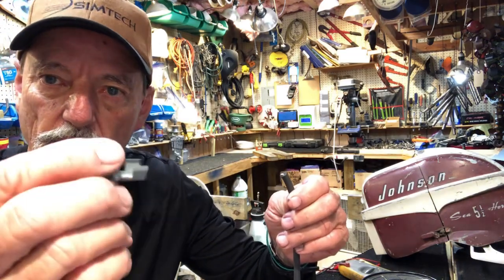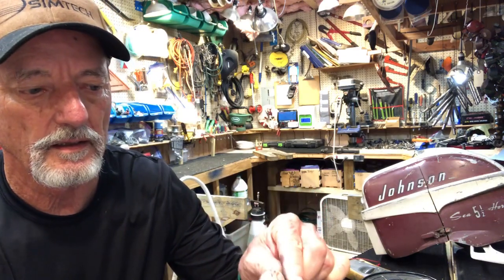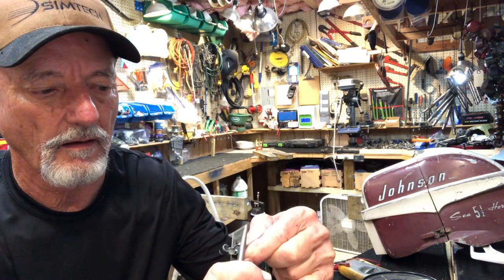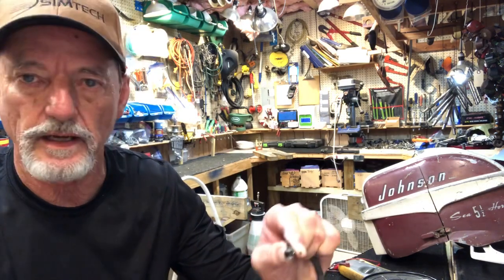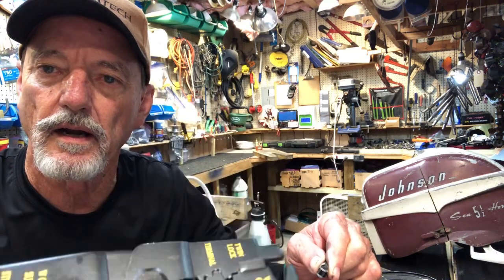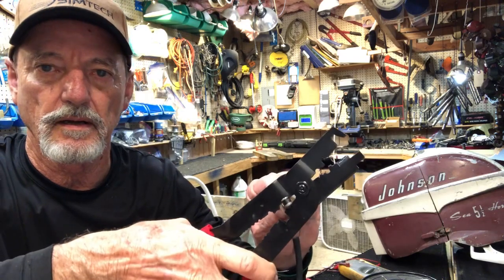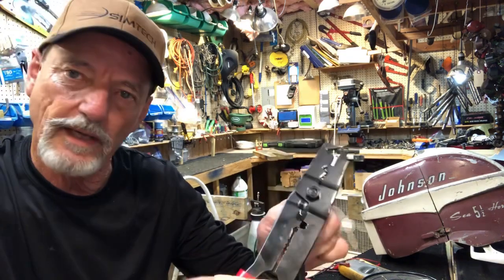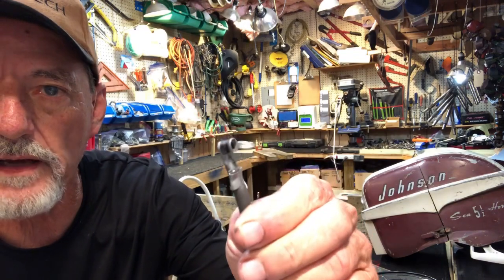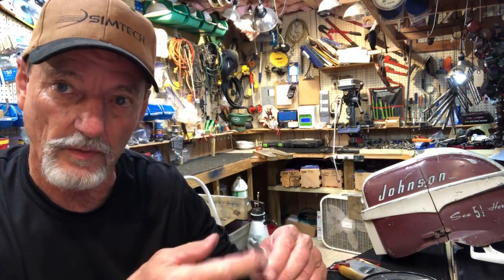Then I'll take my metal boot and put it against that wire, and I like to start it with a pair of needle nose. Just kind of get it going, and then the crimp terminal is right there. This right here. So you put the crimper on it and crimp it all the way down. And you can see the wire still sticking out. You have a nice, solid crimp. It's a pretty robust connection. That spark is so hot that it'll travel well through that connection.